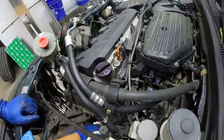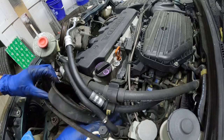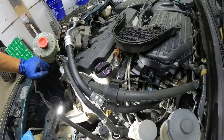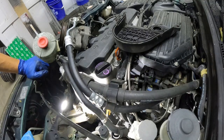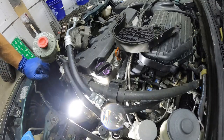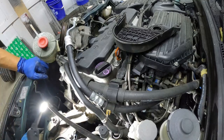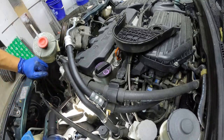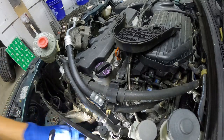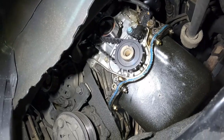The electrical plug here is probably for our cam sensor. Let's give everything a once-over — if you've got to go this far in and you've never replaced a timing belt, it's a good time to do it. But this one was changed about 30,000 miles ago, along with the cam and crank seals. We also changed the water pump and tensioner. Everything still looks good and dry, belt looks good — no problems there.